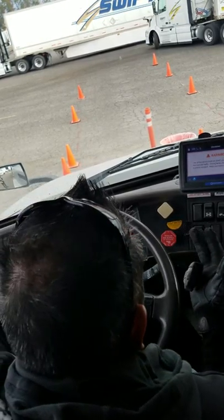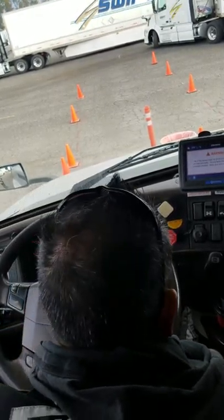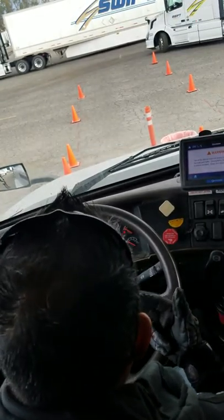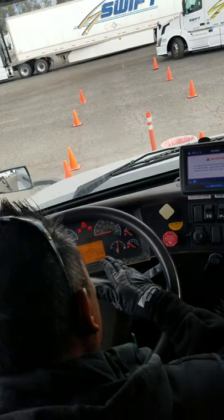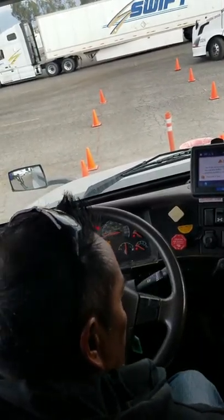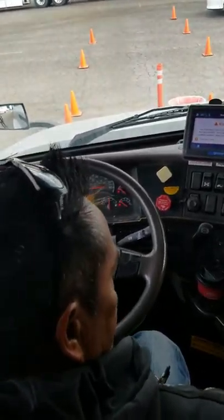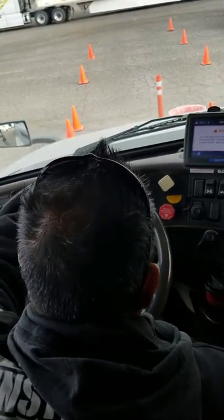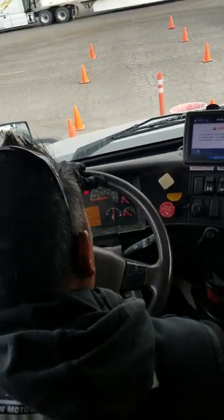All right, so now the next test I would like to perform is gonna be my three-way brake test. But in order for me to perform this test, once again, I have to be at least 100 pounds of pressure. So I'm gonna conduct another safe start. Make sure that's in neutral. The brakes are applied. ABS light's already off because we've been on ignition all that time. Let's go ahead and fire it up.